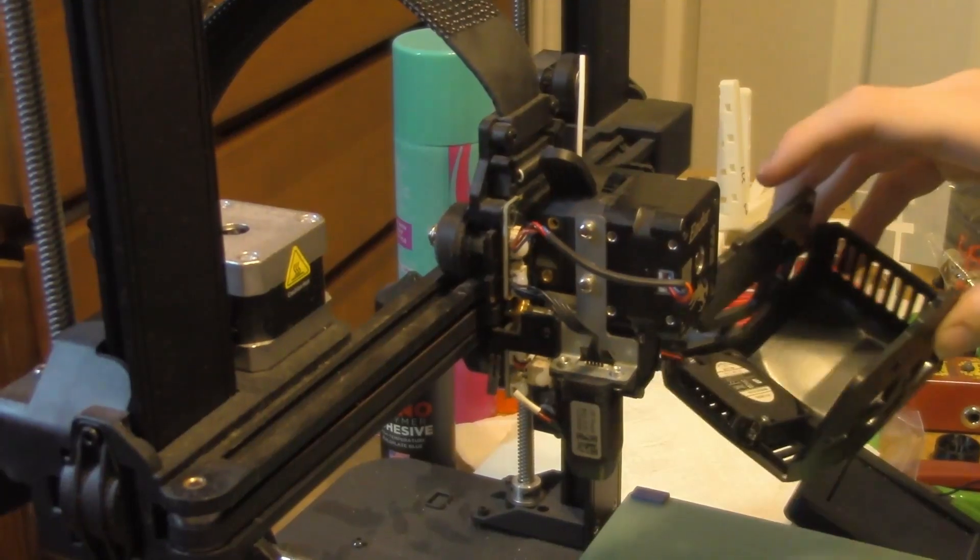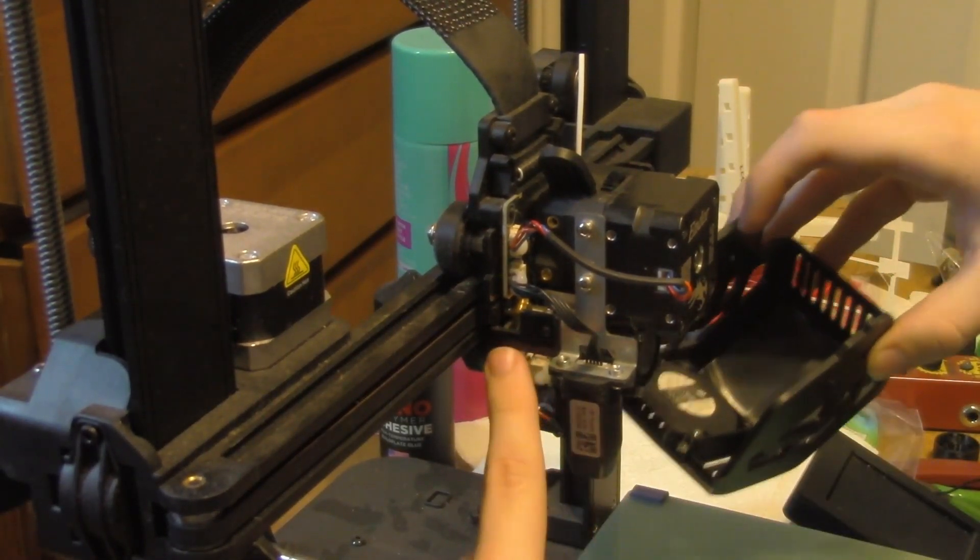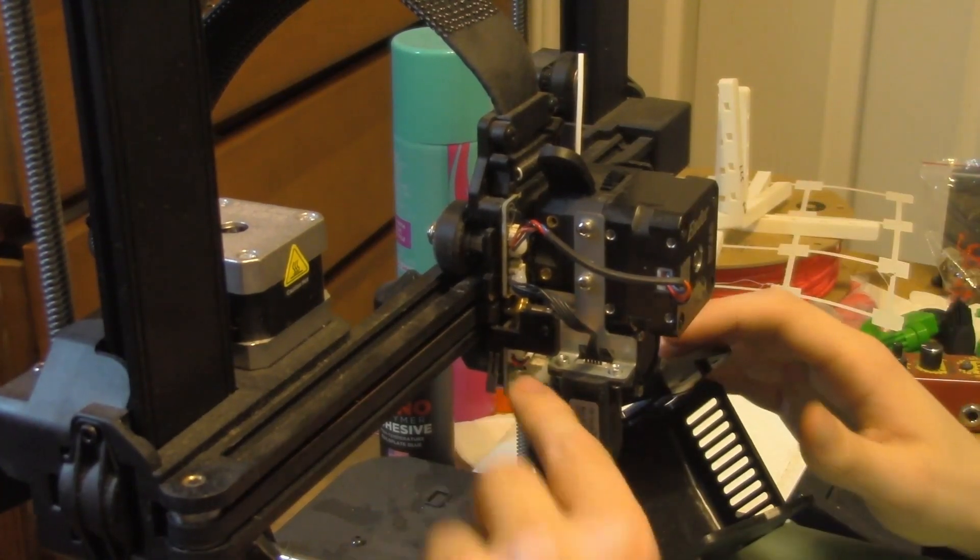While examining the head's tilt, I talk about how annoying the head cover is during maintenance. The cover hangs awkwardly off the head when removed, and there's no good way to have it sit off to the side while still connected to the daughterboard. Removal of the wire is relatively easy, other than the crazy wraparound angle needed to route it. But if you want to reconnect it without fully disassembling the head, it's a nuisance — the connector head often bends the wrong direction and blocks itself from going through the passage.